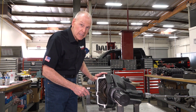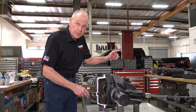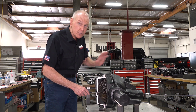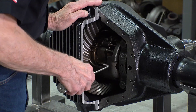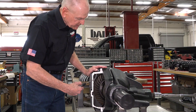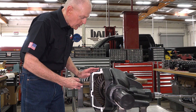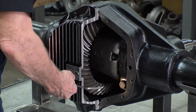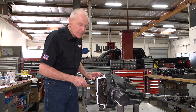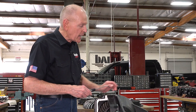That's fuel economy. Any time you heat the oil, you had to burn some fuel in the engine to make that happen. You don't want that. So the ring and pinion are buried — there's impact here and impact here. We saw on the clear cover that the oil impacts up high and falls back into the sump. What gets over the top and out to the pinion bearings is not the proper amount.